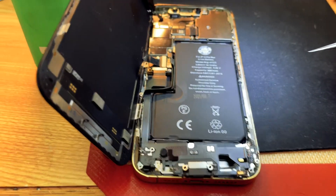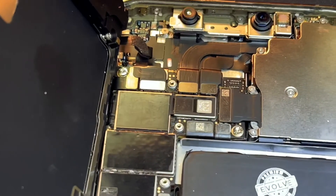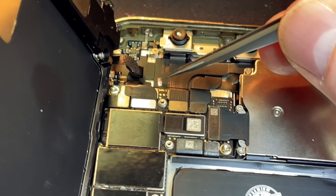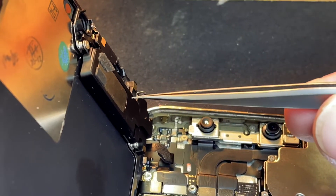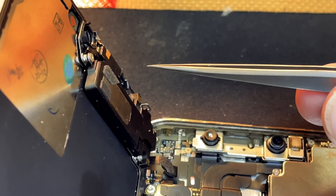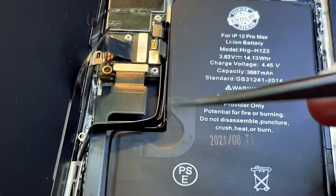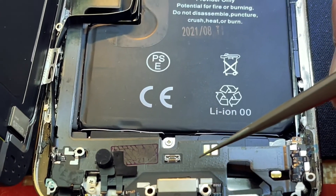Get a phone in — and this one actually has some water damage. If you can see right here, the liquid damage indicator has been tripped. When that is tripped, your proximity sensor could be the issue, but it will not reboot every three minutes — it will reboot randomly. This issue will reboot every three minutes exactly.